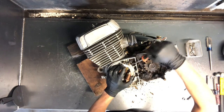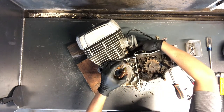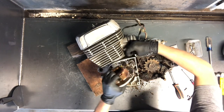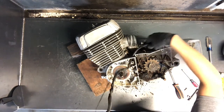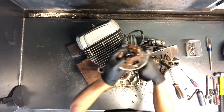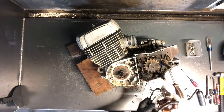This stator here sometimes you've got to take and just get a little push. This is a rubber gasket that seals this up from any debris — you don't want any water, sand, or any kind of junk getting down in here. Once you get those wires fished through there, we can just pull this stator out. We'll test this stator — I'll show you how to do that in a separate video.